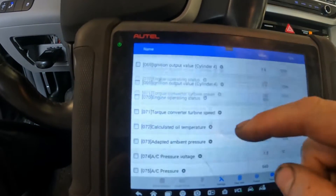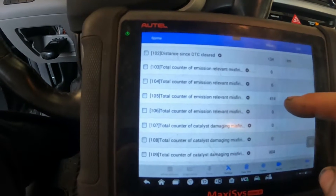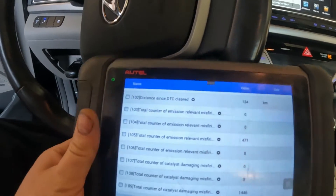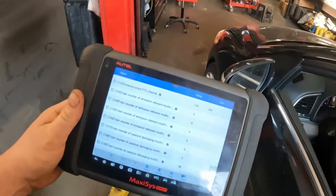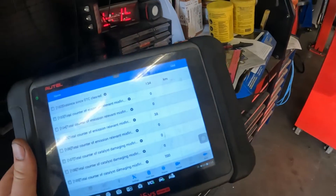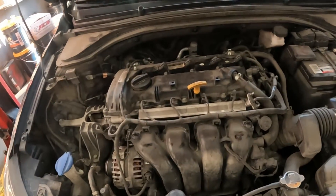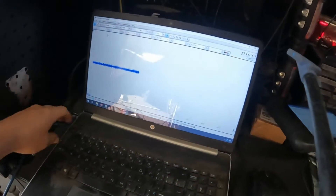There are counters — okay, cylinder 3 is a dead miss. I'm going to see if, while it's still misfiring, I can quickly grab my secondary ignition pickup and see if I can catch whether it's ignition or fuel. Let me quickly try and get that set up. We've got the pickup and the PicoScope set up, and she is bucking.